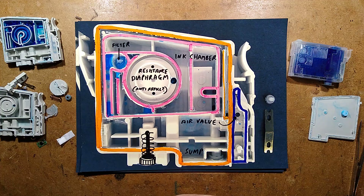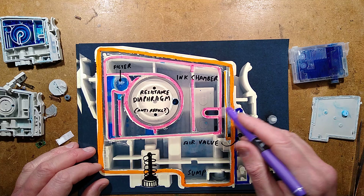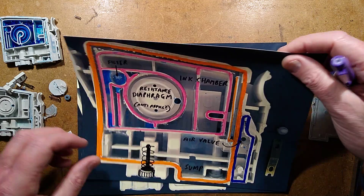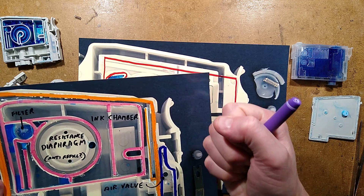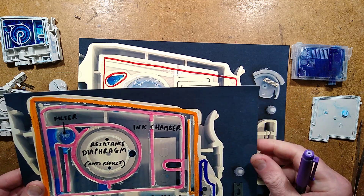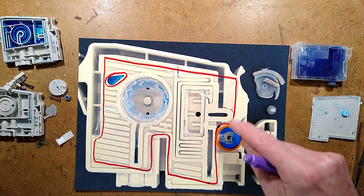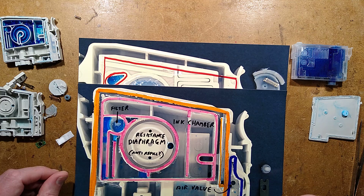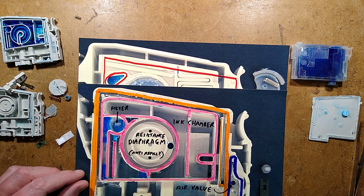And that's what's inside. That took such a long time to reverse engineer, particularly because I didn't realise these bits were there - I just thought it was going to be something simple, liquid out here and air in here and that was it. I didn't realise there was that little valve. Because I'd been sucking the ink out with a syringe, it had drawn a vacuum inside, and when I actually found it and pushed it, there was a loud hissing noise as it let air back into the system. Quite complex, very neat - it looks like this has evolved over time, probably due to shipping cartridges and finding ink everywhere. Very interesting - much more complicated than I was expecting.